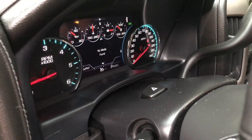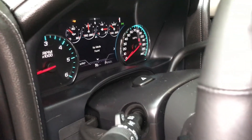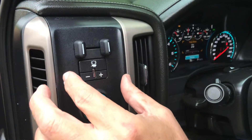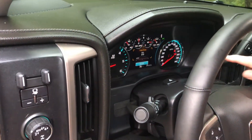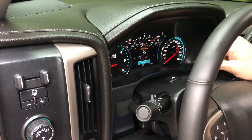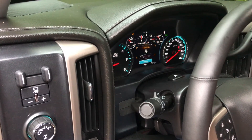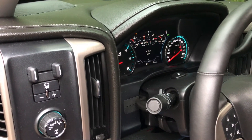That's all dependent upon how you've adjusted your brake device. In the GMC truck, it has a built-in brake controller, and we'll talk about the built-in brake controller here — it's on the left side of the dashboard. You see these little drag buttons here, and what happens is these drag buttons will engage a display on your screen. That will tell you how much gain you have on your trailer from an electrical standpoint to apply brakes to your trailer wheels. It goes from zero, which means it's applying no brake at all, all the way up to ten, which is the maximum brake it's allowed to give to the trailer and tell the trailer to lock up the rear wheels. The trailer's brakes will lock up if they have enough braking power.